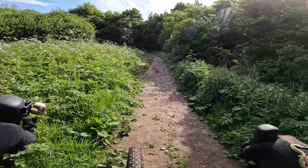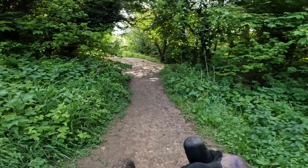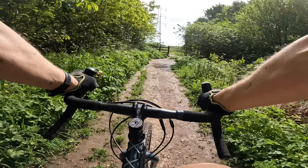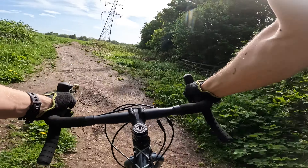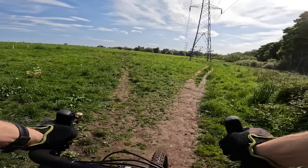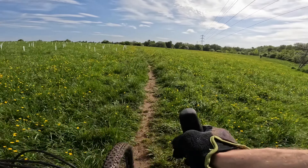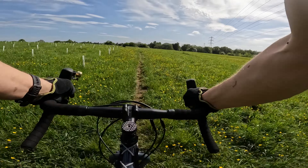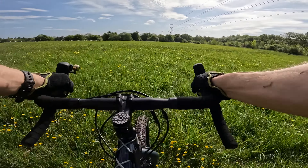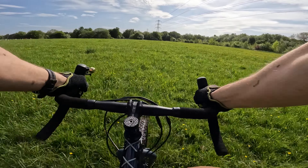For the smoothest ride, you should definitely — even if you still want a rigid fork — opt for the carbon fork. Cyrus is a really high quality carbon fork on the rigid option. So if you don't need all the bosses and mountings, and you're not totally in love with that steel fork look — I'll admit the tapered legs steel fork looks beautiful — but don't necessarily expect miracles in terms of the vibration it will save you from. At least make sure you run tire pressures as low as you can.